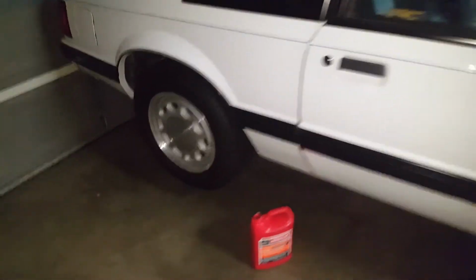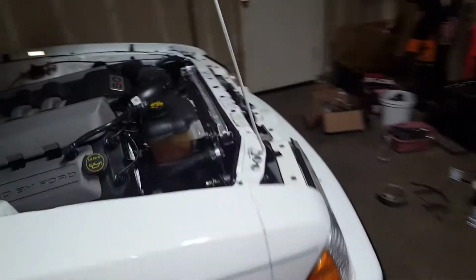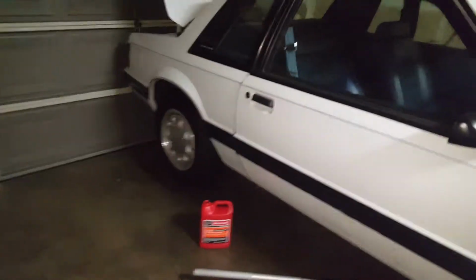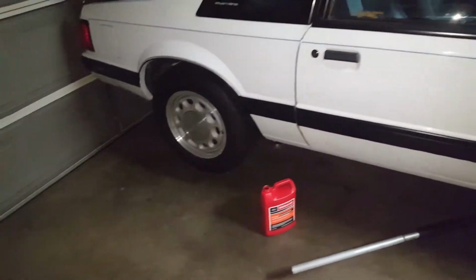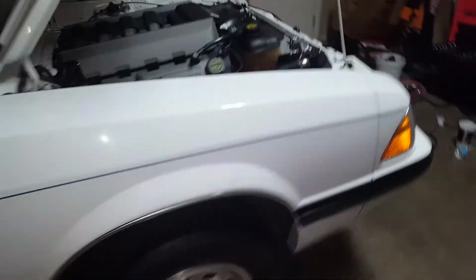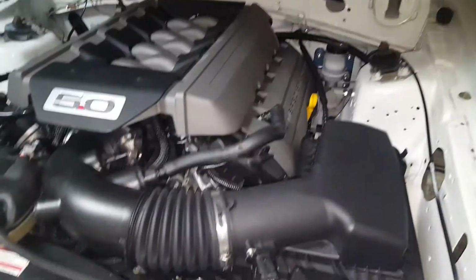It does have a 4-cylinder rear end on it still. Once I get it running and driving and everything, I'll drive it like that for a while to break everything in. Then I'm gonna put 31 spline axles with a 31 spline carrier and probably 4.10s. And another thing, that rear end has 3.73s. It came off of an automatic 4-cylinder. Well, the car is an automatic 4-cylinder, so it has 3.73s, and I want to try out the 6-speed to see how it runs with that.